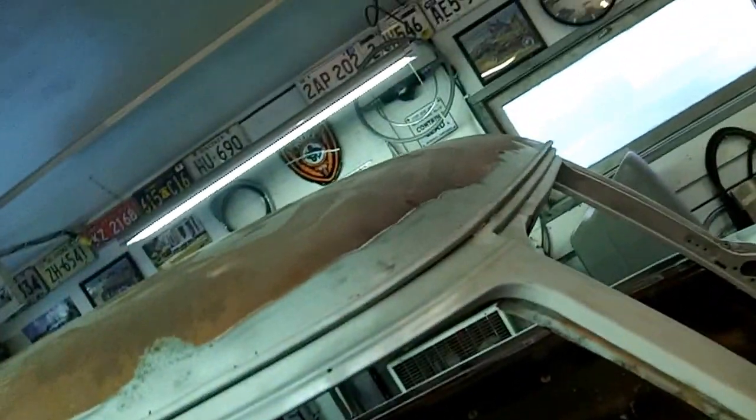And also I did not do the roof. The roof is going to have to be dry stripped. It's too big, too flat. And there are some areas of pitting that will also have to be treated with Ospho, and then epoxied.